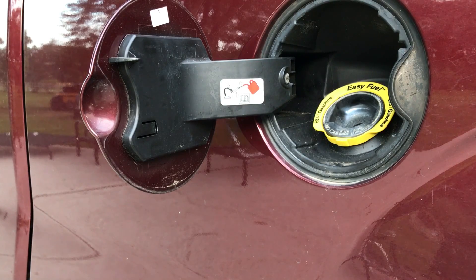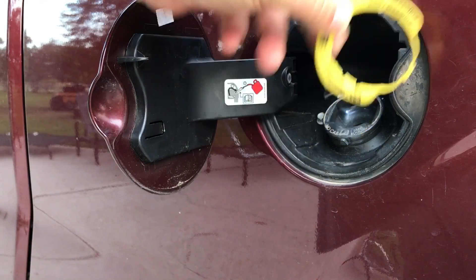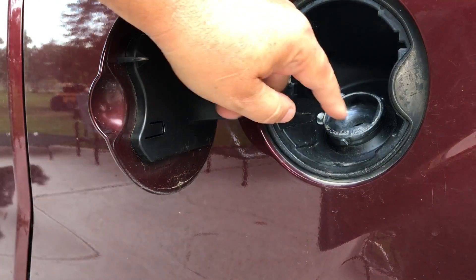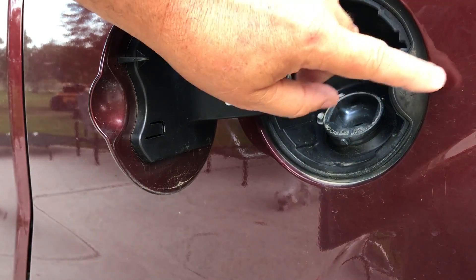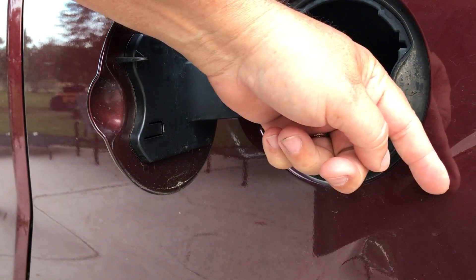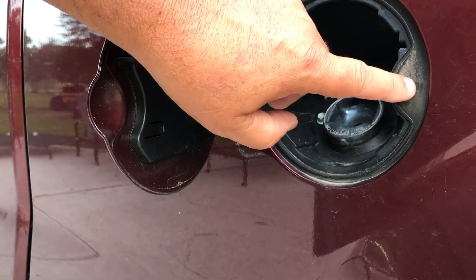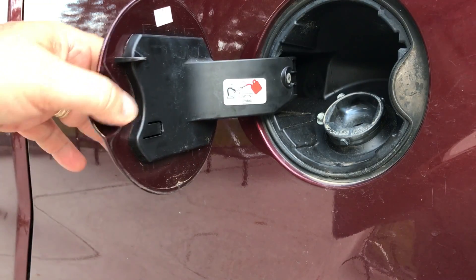The sun still hasn't come up but I've moved my truck a little bit where some of the daylight's getting on it. So here's what I want to show you first: this thing here just pulls right off. There are three 8-millimeter bolts that hold this on and a clip behind this that you've got to reach underneath to get to. I'll show you that, but let's take this plastic door panel off right now.